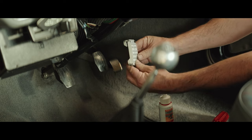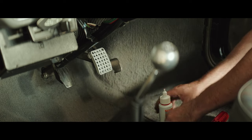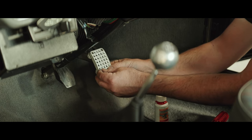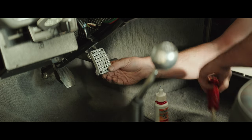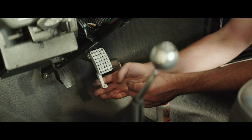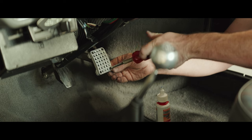That's how it should look in profile view once installed. With it attached like that, put it on top, grab your screws, and add a little bit of Loctite — just a little bit, you don't need much. With it facing this direction from the back, the screws go in on the brake and the clutch at the far corners — here, here, here, and here. Thread them in by hand first — make sure you're not cross-threading, as they are threaded into aluminum, so make sure they're going in nice.